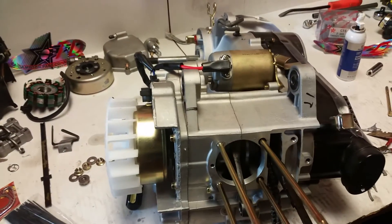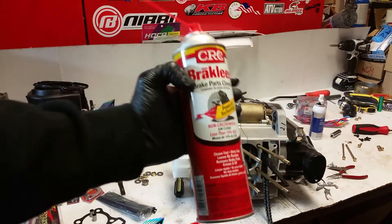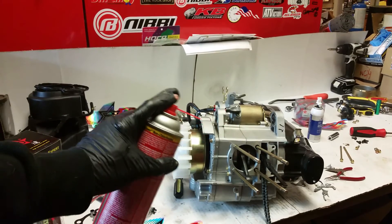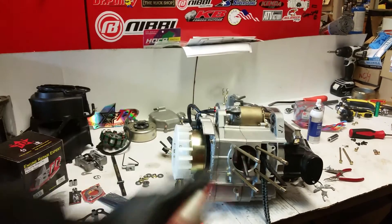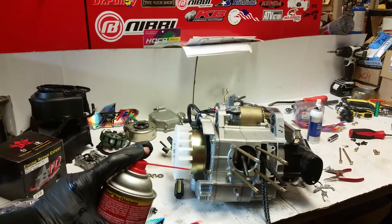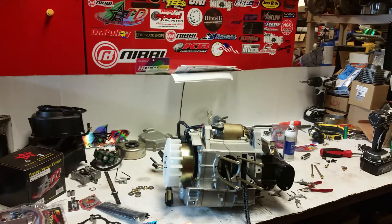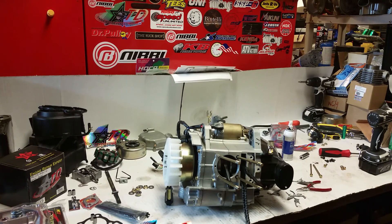You can see absolutely no gasket material left on there — if there were any remaining, you would definitely have a leak. Once done, hit it with a little bit of brake clean. It evaporates quickly but will clean your surfaces well and remove any residual Permatex so it doesn't interfere with your new gaskets. That's it. This is the end of part one. If you'd like to talk about anything you've seen, go to dansgaragetalk.com. To buy any of the parts, visit my web store at shop.martinmopeds.com. Thanks for watching — hope you follow along in part two for the installation.